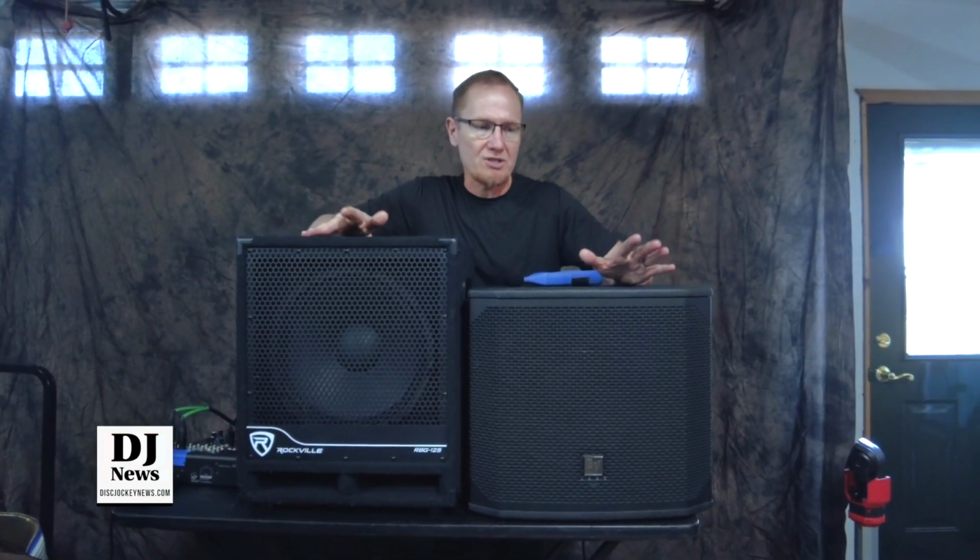So that's where we were. And it was a huge difference. I mean, you saw that there was almost a 4 to 5 decibel difference between the two subs at their max capacity for output, which basically boils down to that you're twice as loud with the EV over the Rockville sub. For some people that need to have that, that is huge.